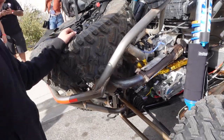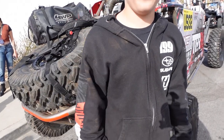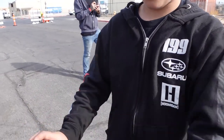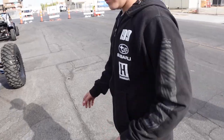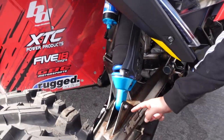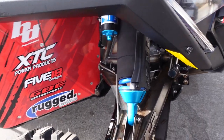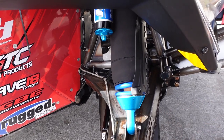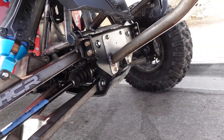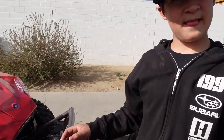Ruslan started prepping the car at 11 a.m. and finished at 2:45 a.m. Prepping means making sure nothing's broken — taking off all the suspension and re-torquing every bolt. He swapped everything out to ARP bolts through PPR, so everything on the car is ARP now, including the A-arms.